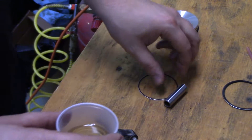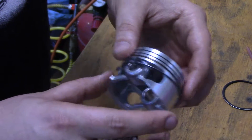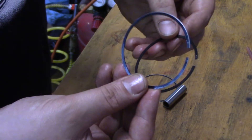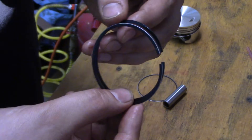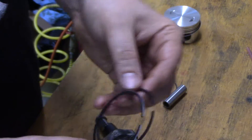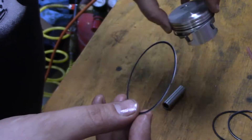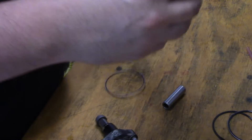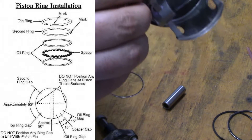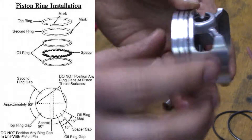Now I'm going to install the piston rings. I've got some 10W40 in a pan here. Here's the piston and some of the rings are kind of started already. Your kit should come with five. You'll get a compression ring — note that it says R at the top; those will go upwards. You get an oil scraper, and then you'll get two metal rings. One's on the piston already along with a wavy-looking one. The scrunchie one you stick on there in the bottom ring groove — it's the first one on the bottom. Then you take one of the metal rings and put it in below it.